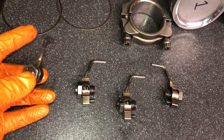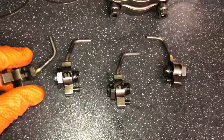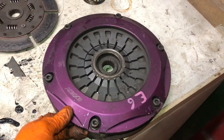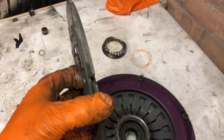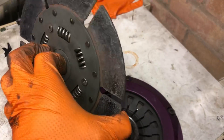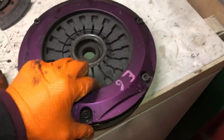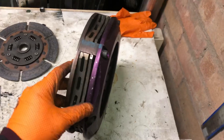When taking out oil squirters, make sure you put them back in the right orientation — this is what an oil squirter looks like, just a high-pressure oil feed to the piston. Moving on to the EVO's clutch: it's a twin-plate Exedy. You can see from the last episode that the clutch plate on the flywheel side had no material left on it. I'm going to unbolt the clutch now and see what else we're dealing with so we know what to order for the fresh clutch.